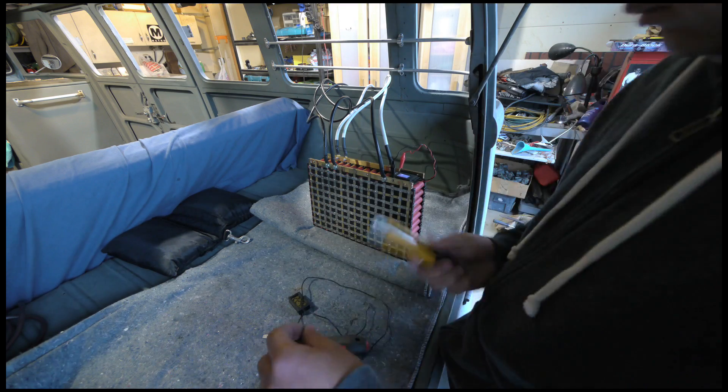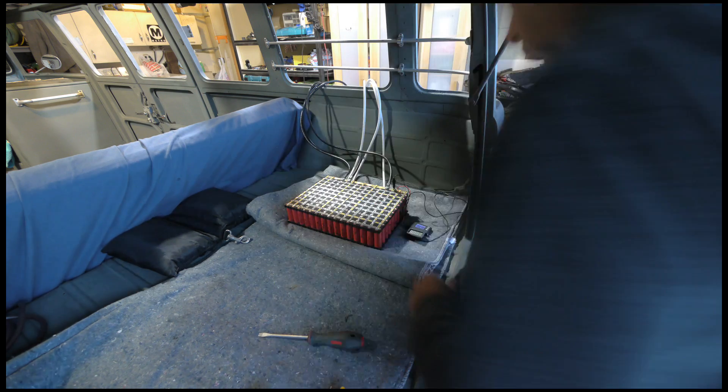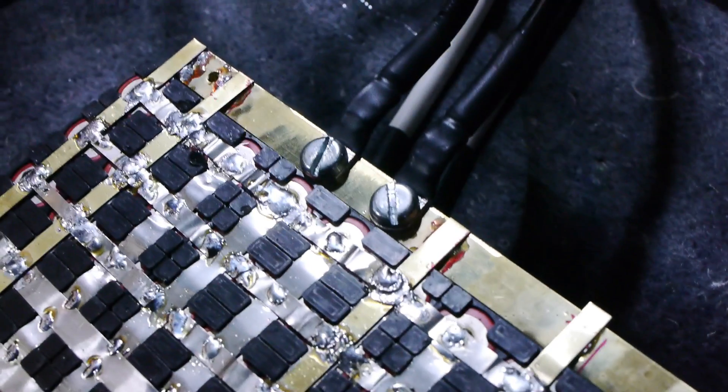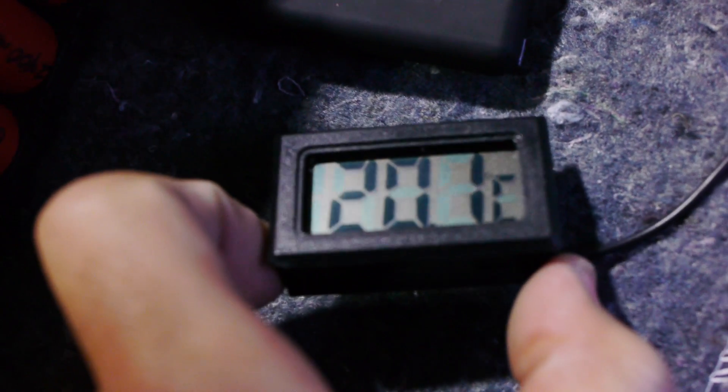Using three 6-gauge cables since they're easier to handle — that's how I plan to do the final pack on these modules. Here's the negative side with a quarter-20 screw, another one there, and another one over there. I'm going to monitor with these: this one is temperature, with a little probe I put in between the cells — currently reading 20.1 degrees Celsius. This other one here is voltage, reading 3.92 volts.